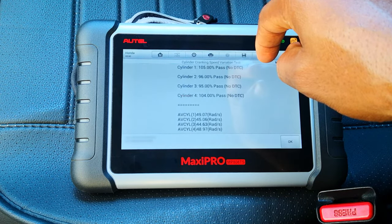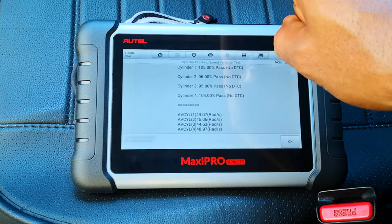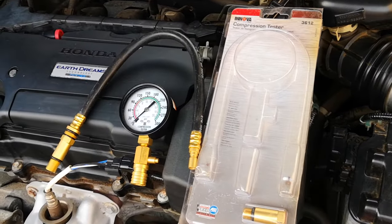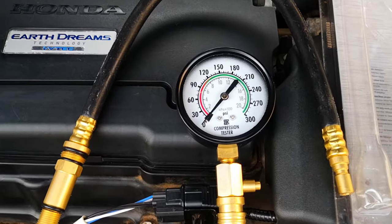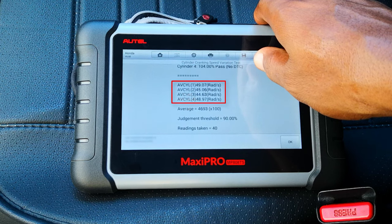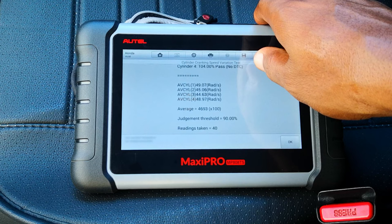There is no low compression in the cylinders. Recall that the instruction mentioned that a pass result is for reference purposes only, so I won't be comparing these cylinder values against each other. If you want to compare actual compression results across cylinders to determine uniformity, you're going to need an actual compression gauge — this test will not replace that. Usually, besides having low compression in a cylinder, you want to ensure that the values are uniform across the cylinders, and that variation should not be more than 10%. These are angular velocity values during the compression stroke of each cylinder. The threshold for low compression for this test has been set at 90%, and the real value of this test is detecting low compression in cylinders — a quick and easy active test you can do before you start getting your hands dirty.